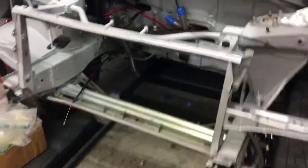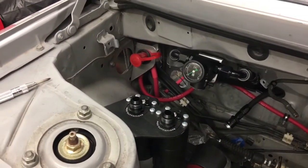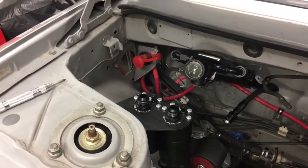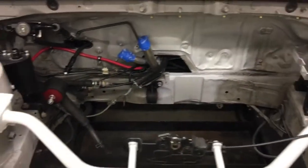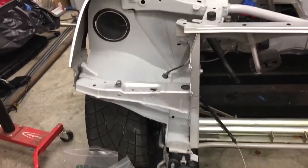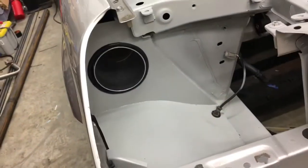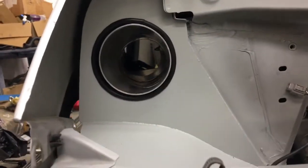Coming over to the car real quick — a couple of things. You can see we've got a jump stud now, which is for the battery relocation so that if you're nose-in to a parking spot and the battery is dead, you can still jump it. The mock-up motor is gone — we're done with that. Brand new mounts in there; those are the Innovate 95 durometer mounts. We may go to something softer if there's too much vibration, but we did that so they wouldn't be moving around with all the torque. We've got all our primer on the pieces we added, and the air box is done. You can see the inlet.